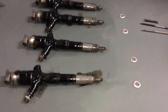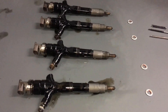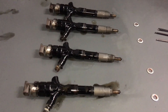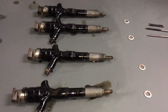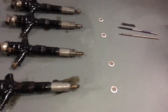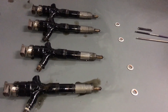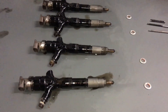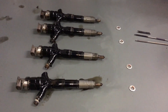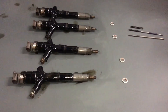The lowest kilometers we've ever seen them leaking is around 138,000 — there are one or two around 130 and one or two around 140. Around 160 there's one or two, and most of them last over 200,000 km. We've seen a number of examples around 230,000 where they've started leaking and blow-by has started. So 230,000 km regardless of which injectors and what internals they've got — 230k on these seats is danger zone. Just because it's danger zone doesn't mean 90% won't be okay, but it's time to do your research, get educated, and prepare to avoid catastrophic disaster.